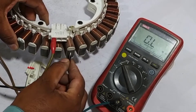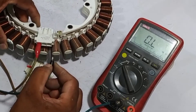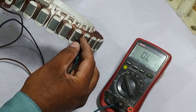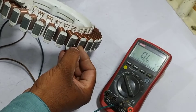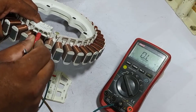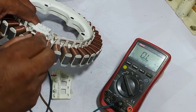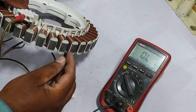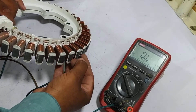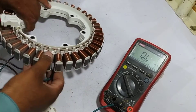The body short test is also important — always test the short circuit. If the motor gets faulty for any reason, you must test the short circuit with all the coils, as it has a plastic body. All 36 coils are separate from each other, so it is important to check all the coils with all the U, V, and W terminals one by one. If any one coil is short circuited, it means the motor is short circuited, and the time has come to change or repair the motor. This is the way of testing the direct drive motor.